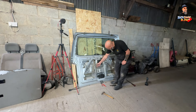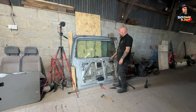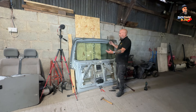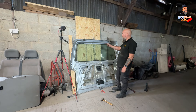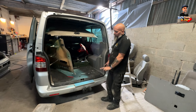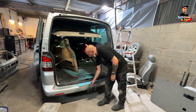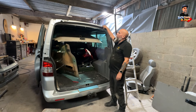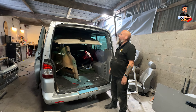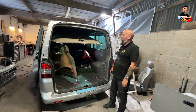I've stripped the wiring out of this door. Apart from this bit, I'm going to have to do some splicing on the looms or change the barrel for the lock over, because that one's been cut by someone. I'm not going to put the wiring loom back in yet because it's probably easier to put it back in the vehicle where it's solid and secure without damaging it. I've lifted it up and plonked it on. I've put a little bit of wood down here just to lift it up slightly — the gap is going to be about 7mm. So that can sit there, and we'll slide in the two holes and do it back up in reverse. Hopefully I'll catch it on camera, but I'm going to put it on time lapse.